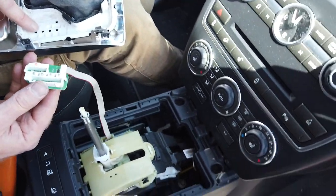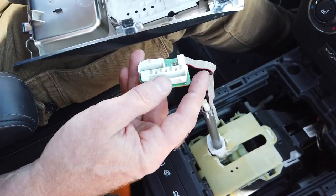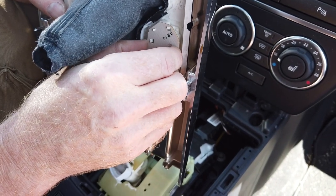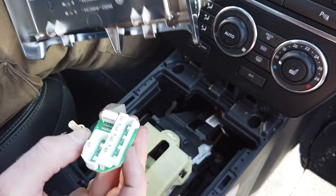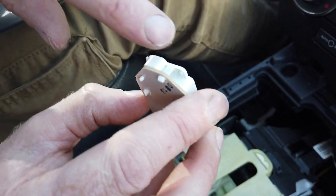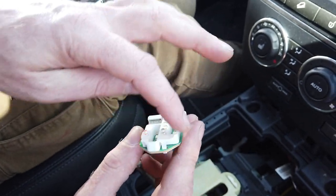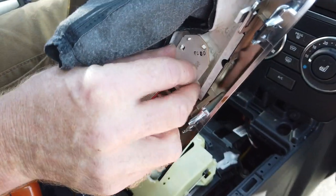Right, now what are we trying to do? We're trying to fix Ben's car here. So somehow this little badge should be attached onto there - it's got four lights there and one more. It needs to go on this way, Tyler. Now I can feel it - that's how it goes on. I reckon it's snapped. I reckon these little plastic lugs here were somehow welded or whatever. So I reckon if we super glue this surface here - we've got quite a nice surface if you look at it sort of flat on.